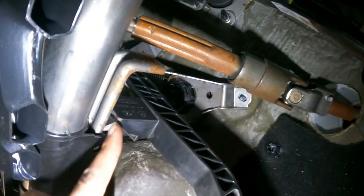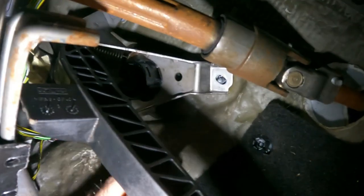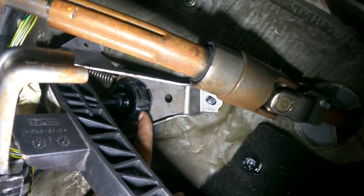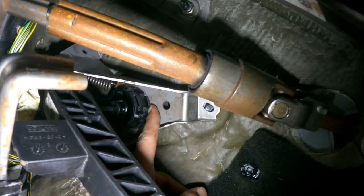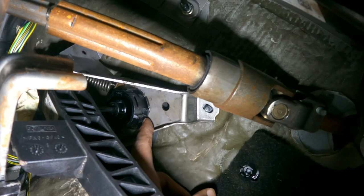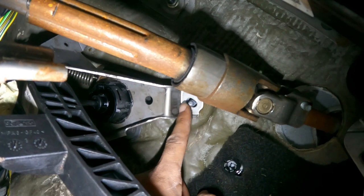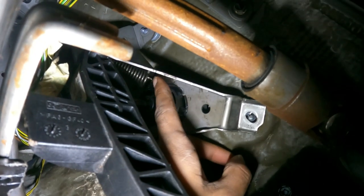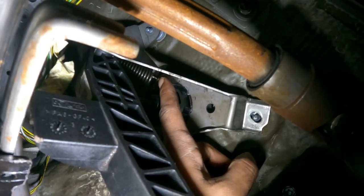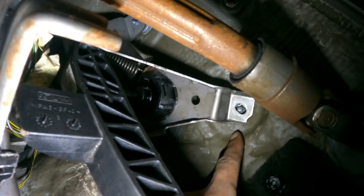I had a friend who's a mechanic help me with this. When removing it, we had to cut this piece out so it comes out more, giving us more space. The most tricky part is taking out this one — you need a pulley grip and then you have to turn it. There is a notch here and a notch here; it goes in with this notch, but then you have to move it so that it tightens and then put the screws. That spring you can see there was broken, so with this new pedal — I bought the new pedal because the notch on the top was broken — the spring is now in and the bolts are in.